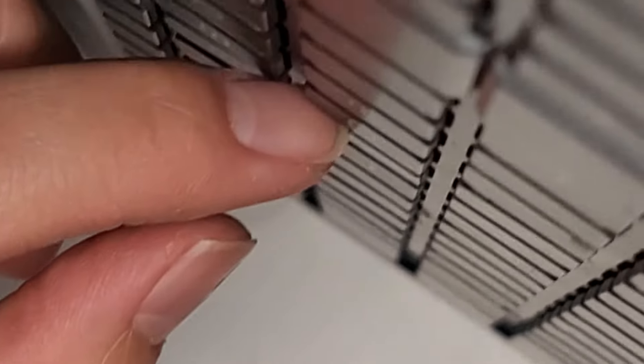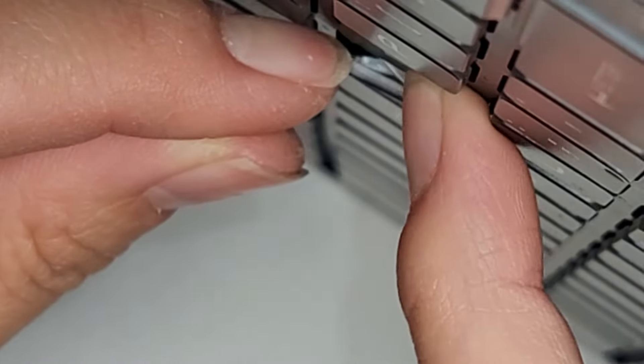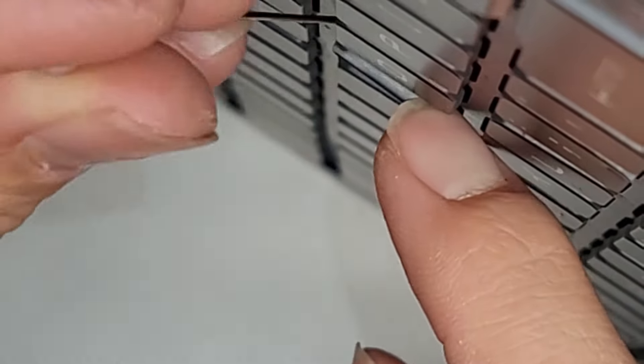I'll try and show from this side. Once we get the needle in there, we're going to work our way to the top to pop that out, then work our way down and pop that out as well. There we go — we've got the I key out. Looking in here, this one actually has a broken piece of that hinge, so we need to replace that as well. That one was kind of holding itself in, so I wasn't even going to get the hinges originally, but it comes with the keys.